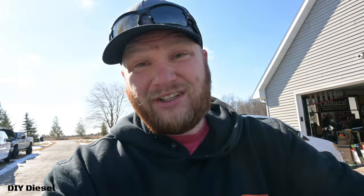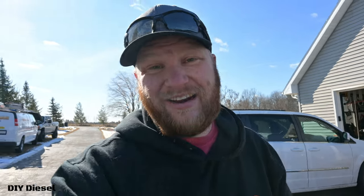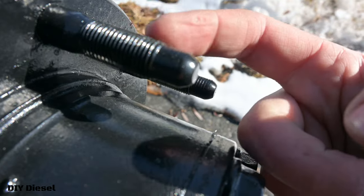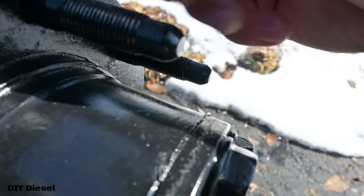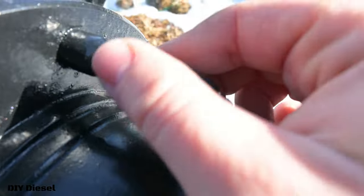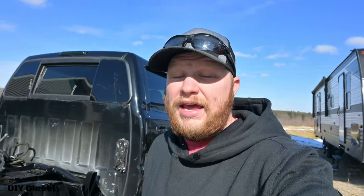I want to tell you guys why I'm doing this. There are other ways you can go about doing this. The Duramax stud, by the way, is an M14 1.5, and that's the largest stud re-threader that comes in this kit. The reason I'm doing this is because I got all sorts of paint on there. I have all this paint in here, and unfortunately when I painted my axle, I got all sorts of paint and crap in the threads. I'm just going to try and get that out to make it a lot easier for the lug nuts to go on — avoiding putting my lug nuts on with the paint and then stripping the actual metal of the stud.